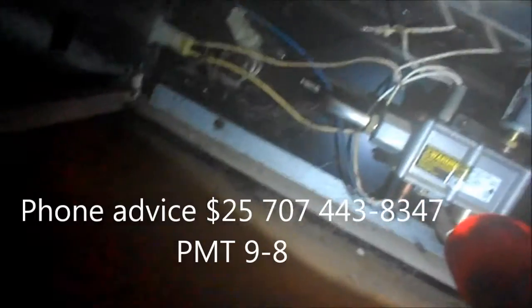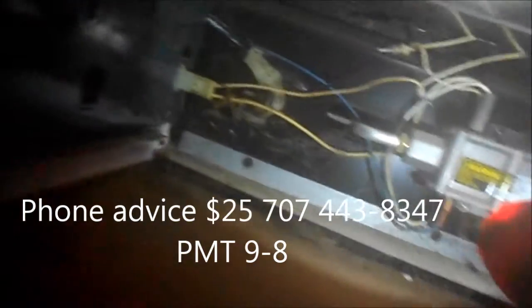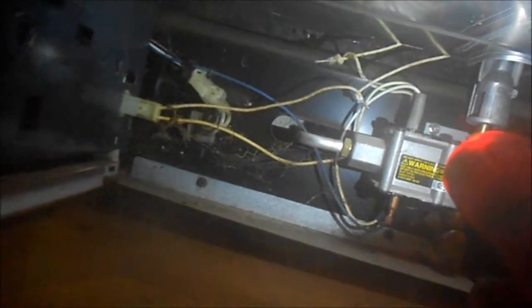And we check these two lines here. These two lines, we see we have voltage. So we can also shut the power off and run a voltmeter through the igniter and check the continuity there. We'll find that the igniter is open somewhere down the line. We don't have any fire in there right now. Somewhere down the line that igniter is open, so we'll have to replace this.